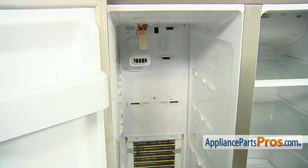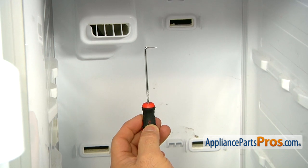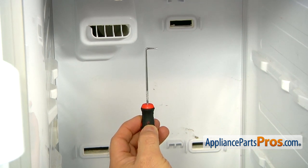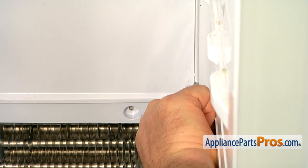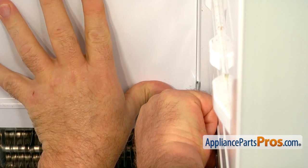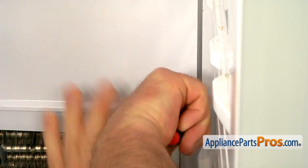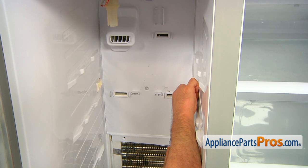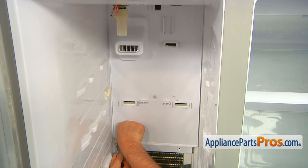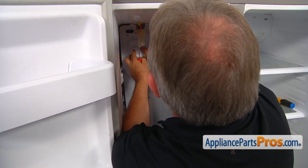We are going to use a hook to undo the clips behind the panel. You don't have to get exactly the same tool, as long as you have something that is bent 90 degrees and won't break the plastic. Preferably it would be a little bit flatter than the hook, but I couldn't find anything in my toolbox. Now, let's insert the hook underneath the panel right against the arrow, then press the panel about two inches away from the edge, pressing and pulling the hook. We're going to continue on to each arrow and do the same thing — press and pull — until the panel comes out.